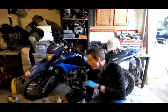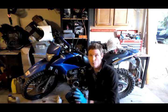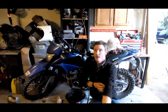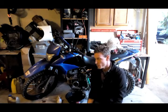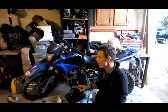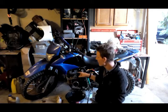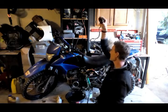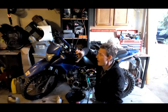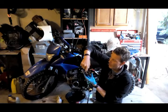The purpose of this video is to find out whether the GY6 stator fits inside a Hawk 250. For those who don't know, the GY6 150cc or 125cc engine is probably one of the most ubiquitous engines on the planet — it's a scooter engine mass-produced in China used in all sorts of scooters, four-wheelers, and ATVs. There are many different sizes: six-pole, eight-pole, eleven-pole, fifteen-pole — the poles being how many coils are on it.